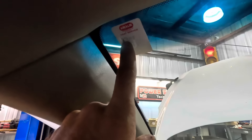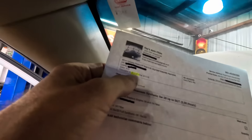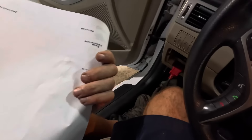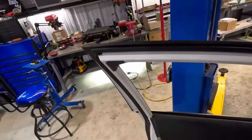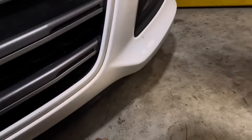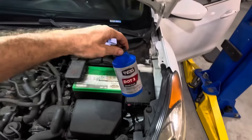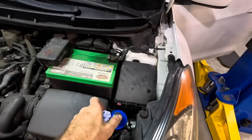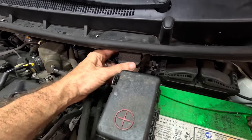I'm assuming it has not been changed since this repair order. If it had been changed by somebody else, they failed to install the sticker. The sticker calls out 87,000 miles — so that's a 6,000-mile interval, which I think is fair for synthetic oil. We're past our time interval, but according to the paperwork we're not there on mileage yet. So we're clearly burning a little bit. Since I don't think we're leaking — and we didn't have a report of leaking — we can rack this up and take a look underneath and see where the oil went.